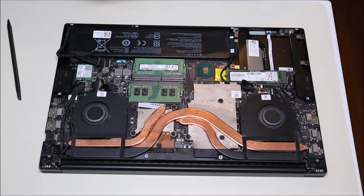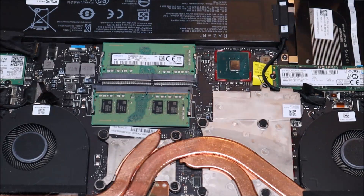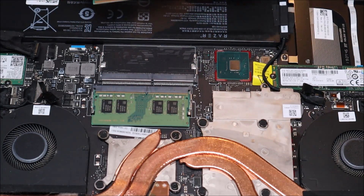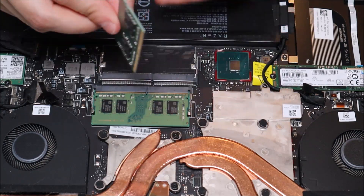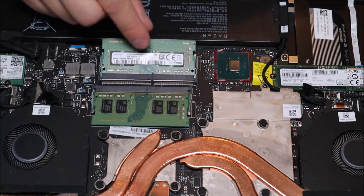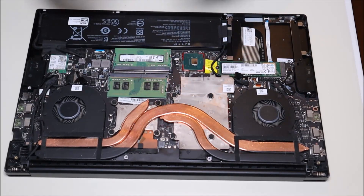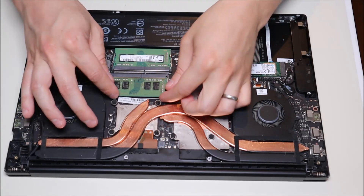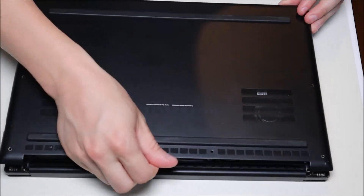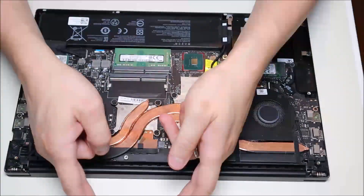These are your RAM sticks here. They're held in a very typical way for a laptop — held in by two metal pry arms on each side. The way to get those up is to gently pull those pry arms apart and the RAM stick pops up. Then the RAM stick will just slide out. As you notice, there's a long port and a short port, meaning your RAM can only go in the correct way. To get your RAM stick back in, just put it in there, make sure it's flush, then press down, snap it in place, and those pry arms will click and it'll be secure. Now that you know how to access and remove your RAM, we're going to remove one stick of RAM and try starting your computer. After you remove that, plug your battery back in, put your bottom case on, flip your computer over, and try to start it. If your computer starts up, it means that most likely that RAM stick is bad — consider replacing it.